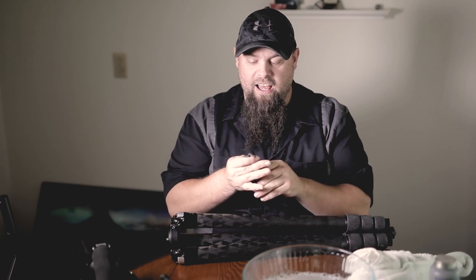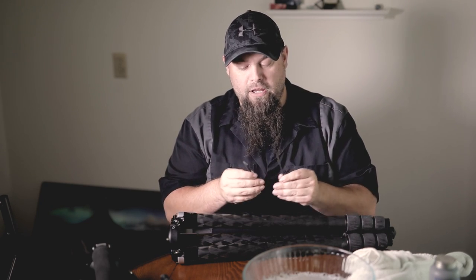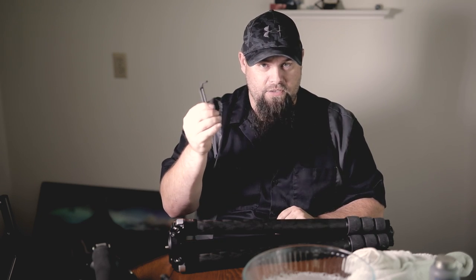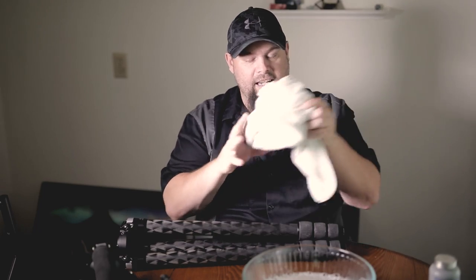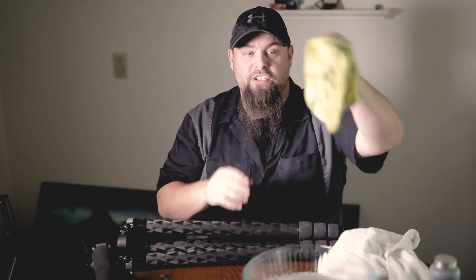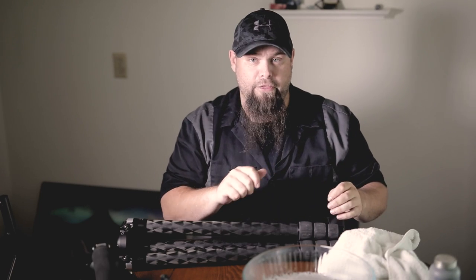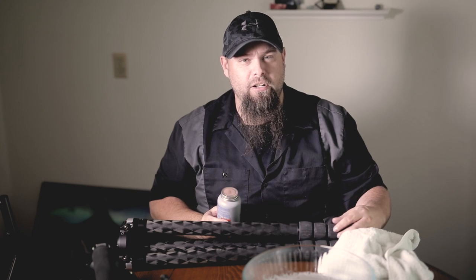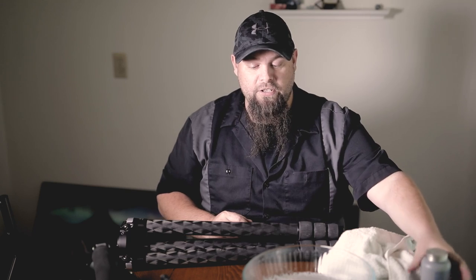So, things that you're going to need. One of the things I like to do every time I take my tripod apart is adjust the tension on the legs. A lot of times they either get really loose and floppy or they start binding up and getting tighter and tighter. We're going to use Allen wrenches to adjust that. We're also going to need a clean towel and a dirty towel for cleaning the grease and grit out of the threads. When we put it back together, we'll use a little bit of bearing grade grease — this is aluminum anti-seize lubricant from an auto parts store — just a little on the threads so they thread nice and smooth. You'll also need a bowl with some soapy water and a bathtub to run your legs under.